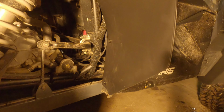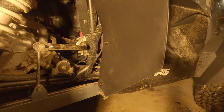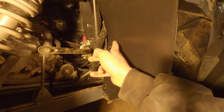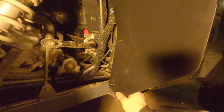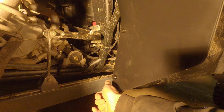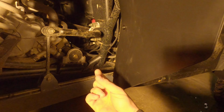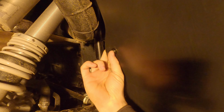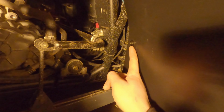All right, moving on to the back fender flare. You can see in the video us taking out these little push pins back here. You don't have to take out the middle one, and you just take out where these bolts go. For this bottom bolt, it takes a nut and a bolt. Then you get the U-shaped nuts that go on the back side here, and then you run a bolt in. Up here, you'll take that screw out of your factory fender from the outside, and then you'll put in that L-shaped bracket with a U-shaped nut on the back of that, and that's where that bolt will run in. The bolt that I would start with is this one right here. That one was the hardest to get lined up.